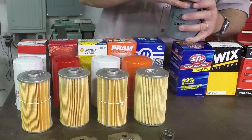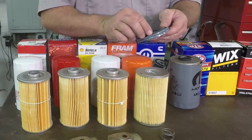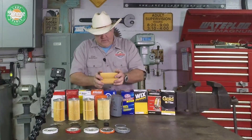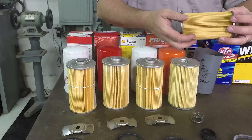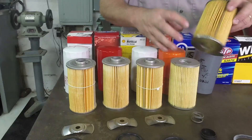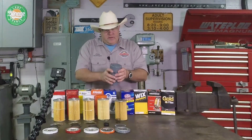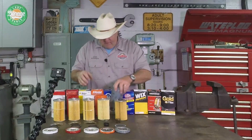Getting over here to the Mopar OEM filter — the base is heavy, with a little bit of an extra thick gasket. Pretty heavy and stout. This filter is very heavy duty. The pleats are very consistent all the way around. The can is heavy. There's also a joiner bar in this one that joins the pleats where they come back together. This one has a proper spring too. The can on this one is also very, very heavy duty — you can feel that it's significant.